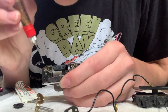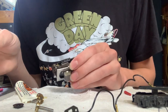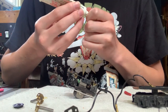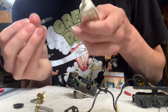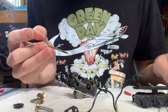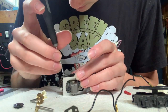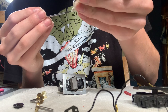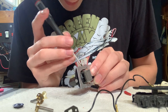Oil right there in the motor. It can be a little difficult to get in there. If you aren't too accurate with your oil, put it on a very thin-tipped applicator — maybe even a toothpick. Then get the grease out and take your blob of grease, stick it on top of the gears and into the gears. Do that for both sides and make sure you get everything — it'll work its way in eventually.